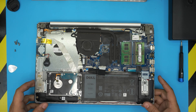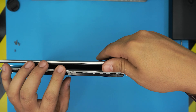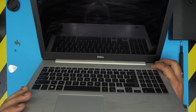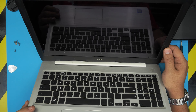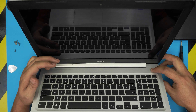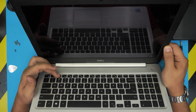Right here you can see the battery and the RAM. Now, people always worry about disconnecting the battery before touching the RAM — you do not need to remove the battery before replacing your RAM or hard drive. It's absolutely not necessary; I've been doing this for more than 18 years. But if you want to be safe, just grab the white battery connector jack by the corners, pull it straight back to disconnect it, and leave it there while you work. Then push it back in when done.